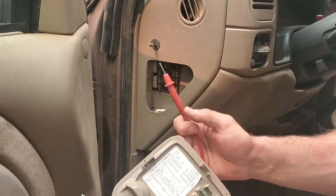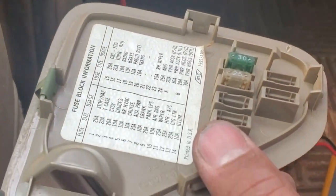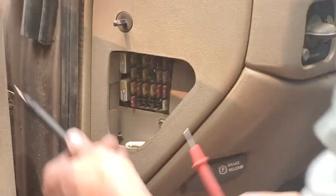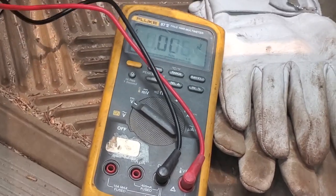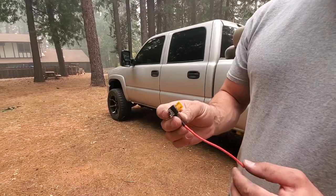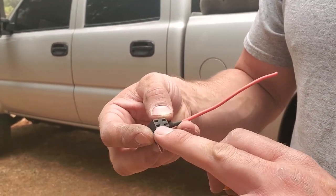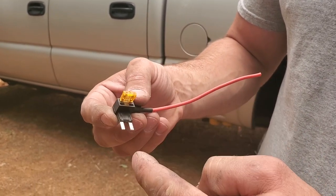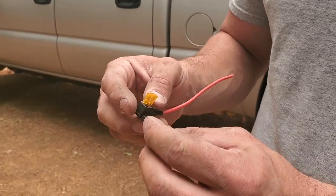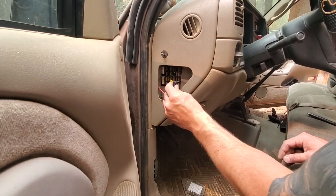I'm going to use the fuse box under the dash. On this truck there's nothing in fuse slot 23 — that's for the rear wiper, but trucks don't have rear wipers. Look at the meter: no amps, no volts. Turn the key on — we got 12 volts. This is the fuse tap. You take the fuse out, the fuse you're replacing goes in the bottom, the fuse for whatever you're running goes on the top. And these are directional — because electricity goes from here through there, so if you run it the wrong way it's bypassing the fuse. We'll run it through the crack under there.